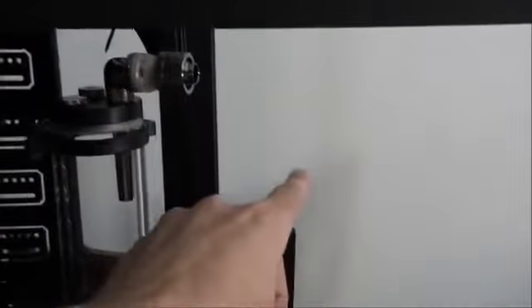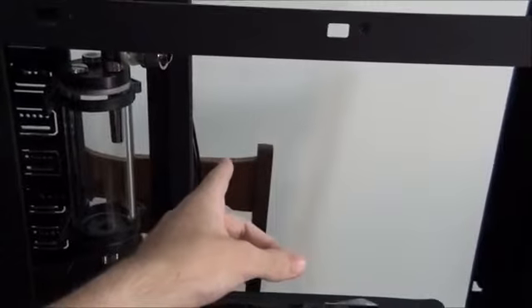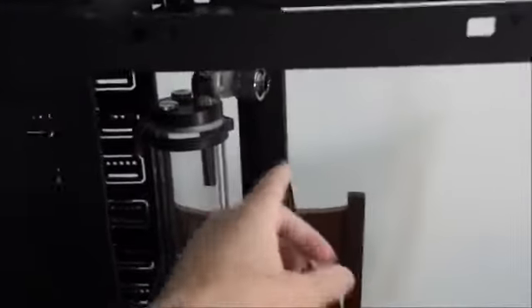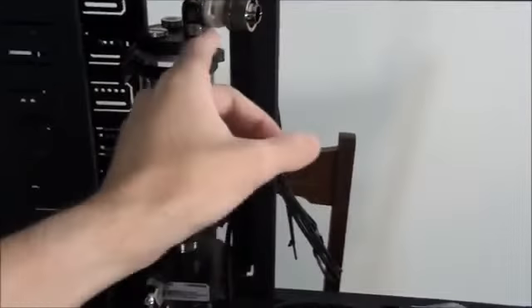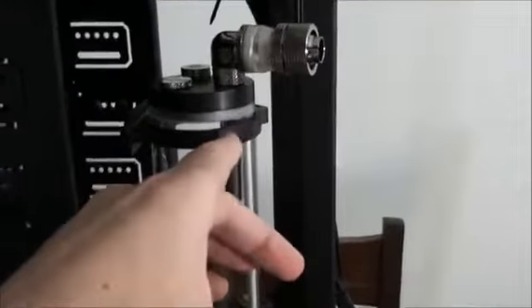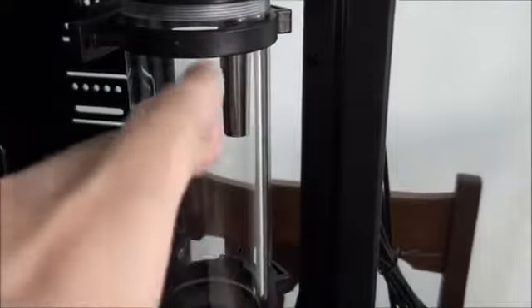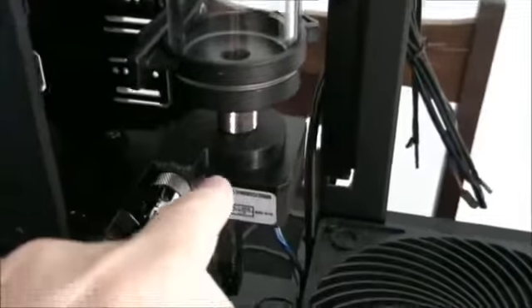The graphics card outlet is going to be somewhere up here, close to the reservoir. Considering the motherboard is in here and the two graphics cards are somewhere there, I'll probably need to put a 90 or 45-degree fitting here. I've got a compression fitting, a coolant filter, and a BitsPower 90-degree single rotary there. I've put the tube inside the reservoir to get the coolant inlet down below the level of the coolant, so it doesn't trickle, splash, bubble, or make noise. That's coming back from the graphics cards and out the bottom, straight into the pump.